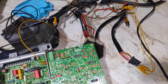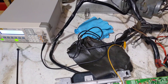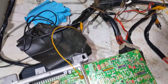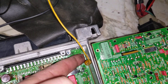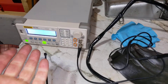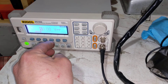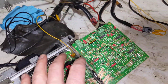Now you need to simulate the pulses from the ignition coil, and for that you need a function generator. The Jettronic system is used to getting the coil flyback voltage, which is really high — like a couple hundred volts — so they have a very large resistor to protect and smooth that out. All I'm doing is bypassing that resistor so I can feed it a more reasonable voltage. A 10-volt peak-to-peak pulse wave at about 15% duty cycle seems to be working great — it's enough to get the ECU to trigger.